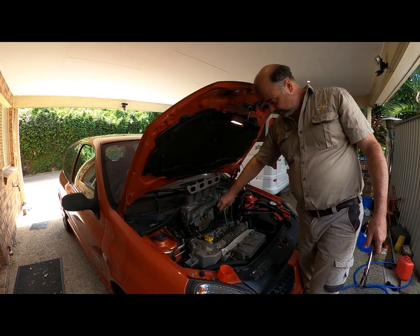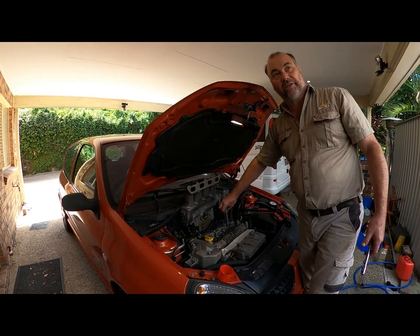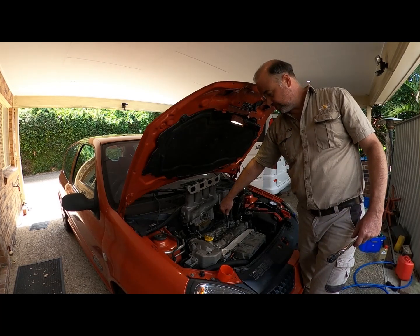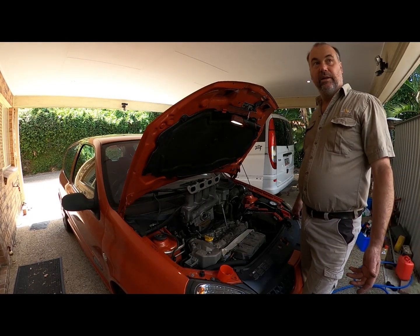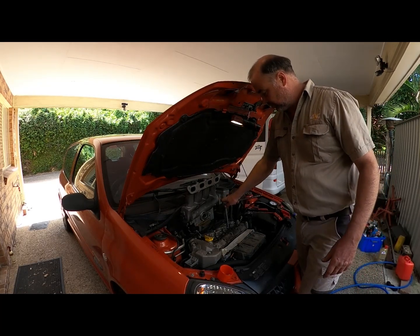No, look, we could have another issue that we need to look into. It could be a knock sensor issue. Yeah, look, it runs fine. I'm just comparing. If you get a faulty knock sensor, it'll retard your ignition timing, kick your timing back so you don't get the zoom at the top end. It'll also use more fuel and run the engine a bit hotter.